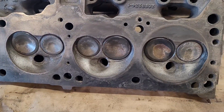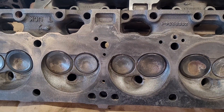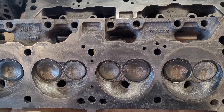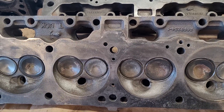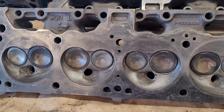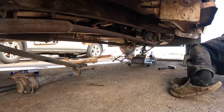That's unfortunate, but on the flip side we're going to have some good content. What I'm thinking is we'll pull a junkyard 5.9 360 Magnum along with the 46RH or 46RE depending on the year, and swap that in. Not only is it going to have a more modern motor design — still based off this platform — it's also going to have overdrive. We may retain the fuel injection, which could be a nice thing, plus it's going to be a 5.9 over the 3.18, so a nice little bump in torque. Let's not waste any more time — let's get to it.